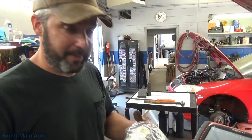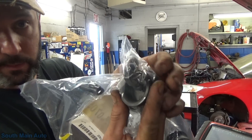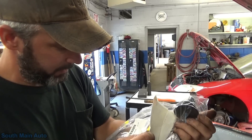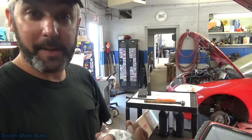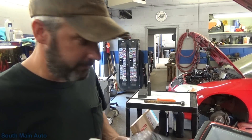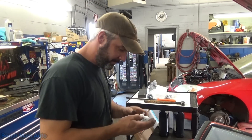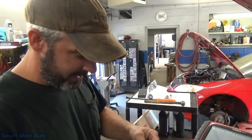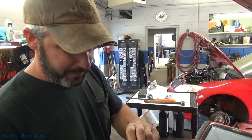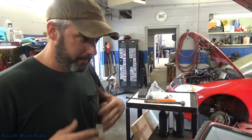If you're working on one of these old Chevrolets, make sure you get the wiring harness for them. They do have these little rubber plugs that go down in — you've got your single wire connector. Here's what the knock sensors look like. They are pretty sensitive to torque specs, sealant, and debris, so there are lots of bulletins on them. Make sure you don't over-tighten them.